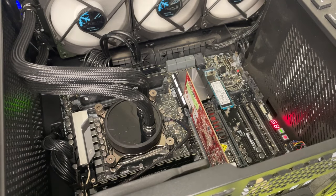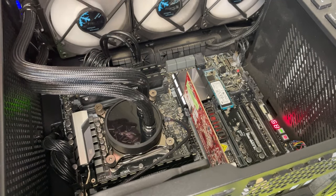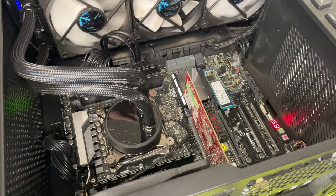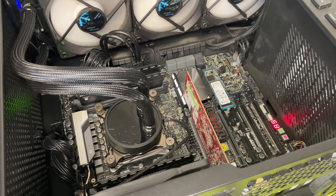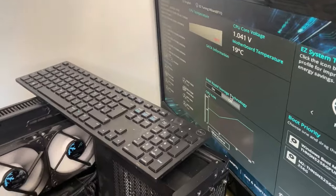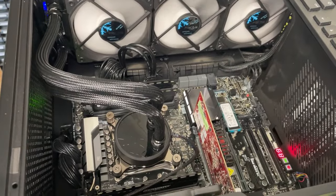It started to go a bit funny, but I'm not quite sure what's happening here because it's reporting that the AIO pump in there is working. So it's on pulse width modulated mode at the moment. If I change this mode to automatic, then that all goes dead. I think it will control it and come on as and when. You put it to pulse width modulated, everything starts up. But since it's been on, which is only a few seconds, it's now up to 73, 74, 75 degrees. Basically it's just cooking itself.